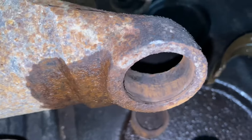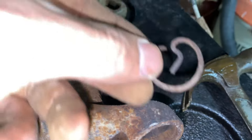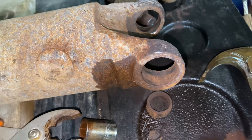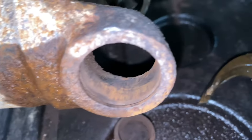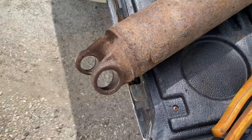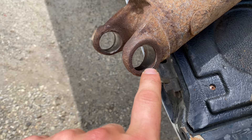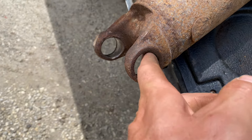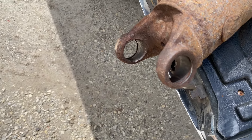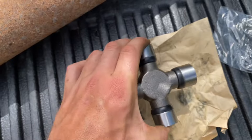You really want to make sure that this groove in here — that is where the clips were — is nice and clean so that the new clips will slide in nicely and be properly seated. Once you get everything cleaned out, make sure this groove where the clip sits is clean. I just hit everything with steel wool to get it down to bare metal again.